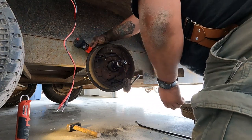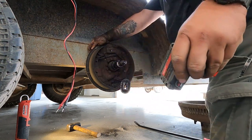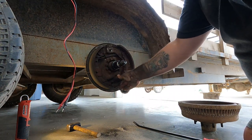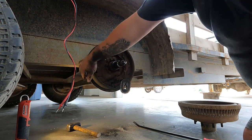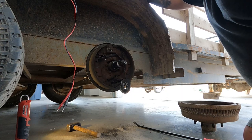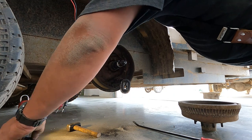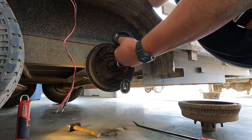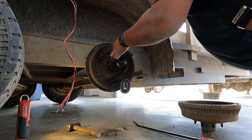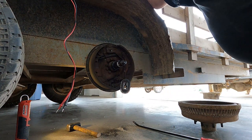The magnet is working, but we're missing the clip that holds it in place, that goes on to this here. So maybe that was part of the problem, maybe it was just corrosion in here, and yeah, probably pack the bearings again and go for that. I can't say I've ever seen one of these before. The seal has its own runner built in that is a tight fit on the axle there. So, didn't want to come off very well.